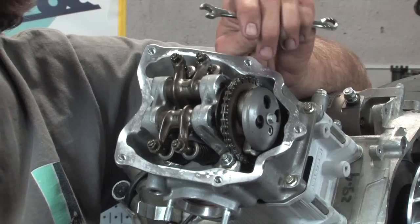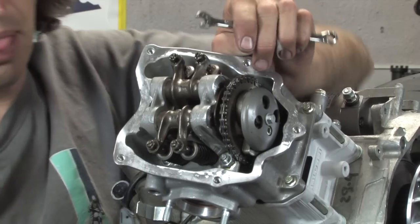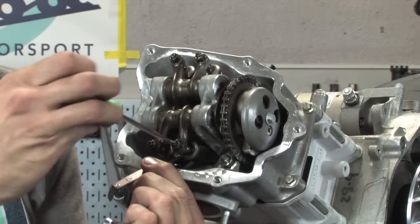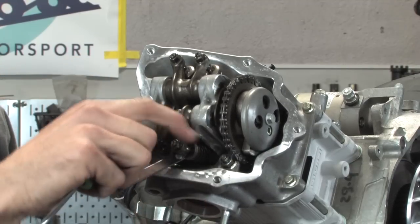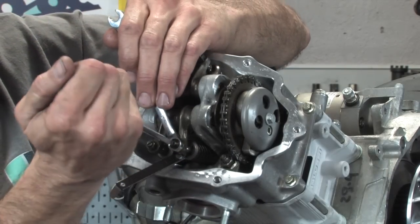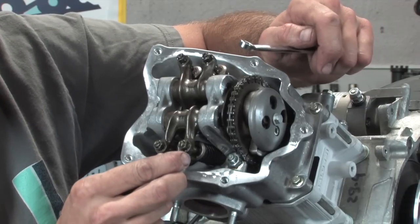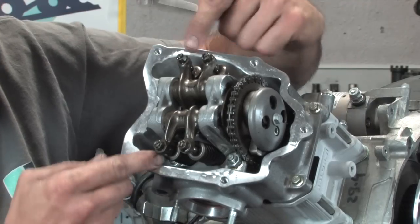With the exhaust, you want to set that to 6/1000ths, about 1.5/10ths of a millimeter. Again, I can't get in there because I have zero clearance. Back this out. And right when it stops, get the lock nut bottomed out, hold the screw in position and snug it up. And again, that slides in there just nice. That's just what you want, where it just drags through. And I'll do the same with the other ones.